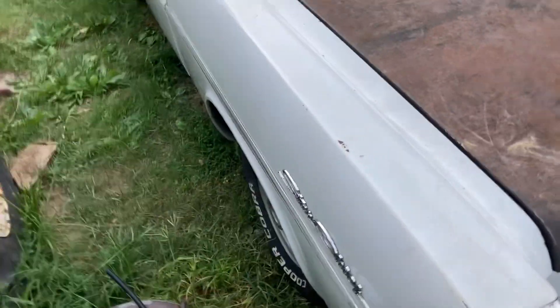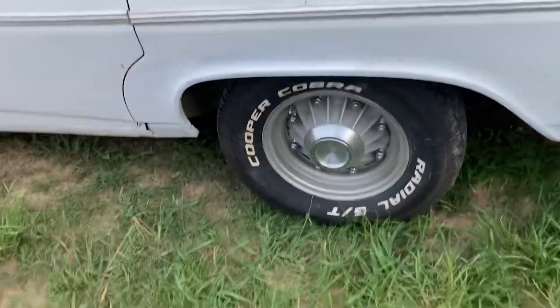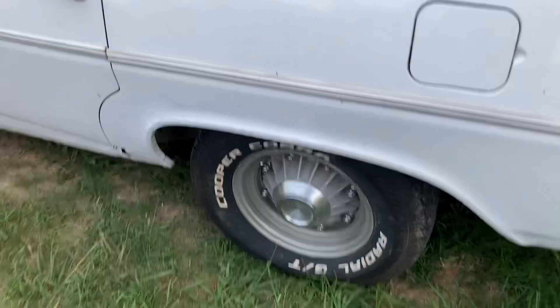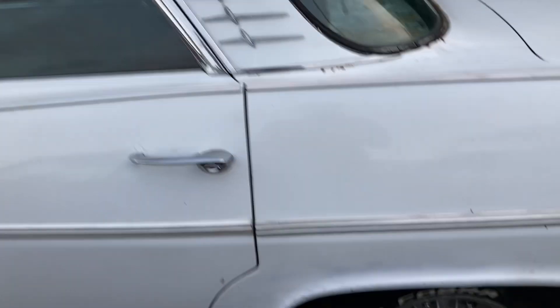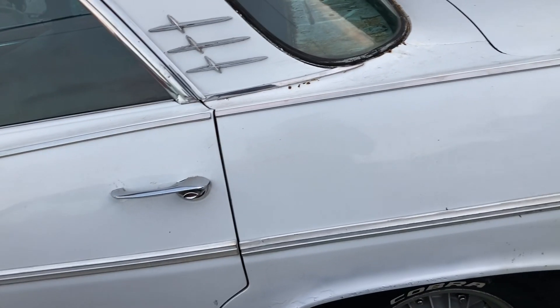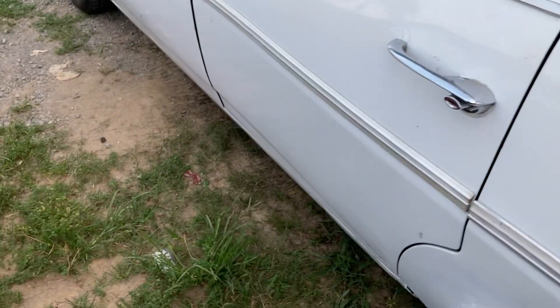With the air cleaner off and running down the road, it does a little bit better. It still does it at full throttle in a low gear. I think it might be because of the rear-end gear being a 2.69 from the factory — it really needs a 3.23 or 3.42, and I think that would take it away. Or it could need more advance, which I've got locked out right now. The fuel pump is definitely a success and did help our problems tremendously. This one is 80 gallons per hour at 6 psi, and the other one was only 40 gallons per hour at 6 psi, so it made a good difference. Thanks for watching, and don't forget to like and subscribe.